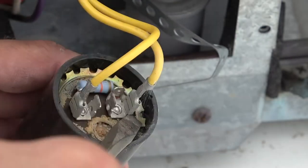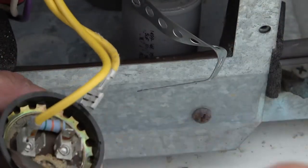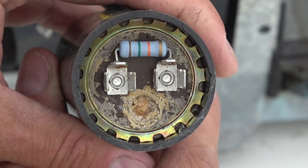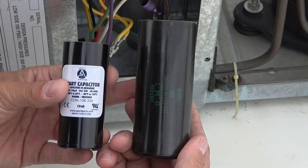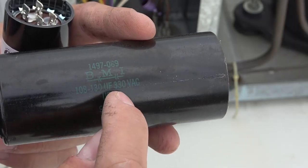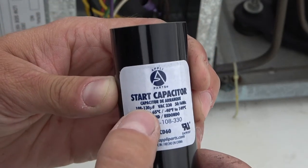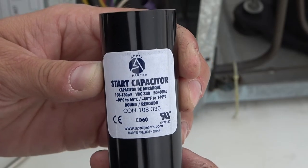So we're going to pop these contacts off. I'm still going to be careful not to touch this — I'll just carefully pull this off. Again, there's what it looks like on the top. Now the new capacitor that I bought on the left here is a good bit smaller than the old one, but what you want to do is just look up the rating. If you look on the old one here you can see it's rated for 108 to 130 UF at 330 volts AC. And this new one is also 108 to 130 UF at 330 volts AC. Just make sure you get the right rating capacitor and you should be fine.